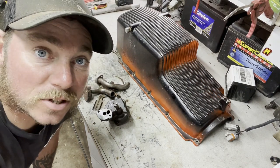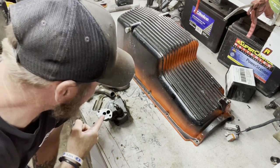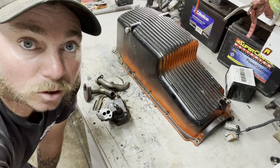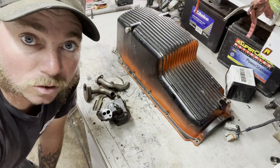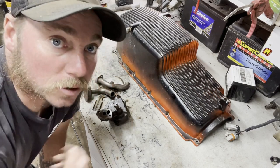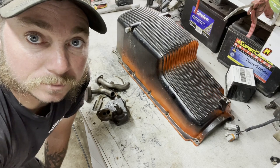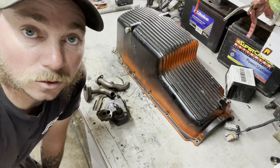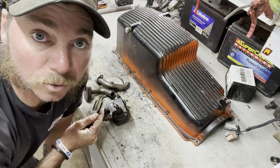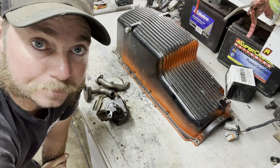On this episode we're going to be modifying the sump oil pump and the pickup to suit the big block into the Commodore and the crossmember. We'll be using the top of this and fabricating our own bottom, along with the oil pickup and pump. We'll be running an external oil pump on this engine, same as one of my mates.